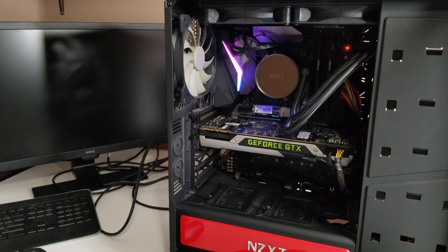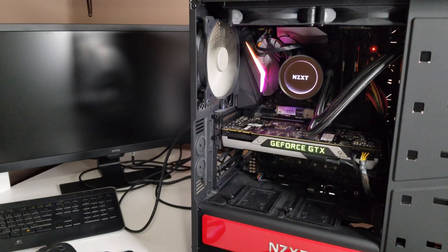Let's turn it on and see what happens. This is an Intel system from a while back — it's an i7-7700K. I'm still getting no display. But the system is not powering down. If the CPU was overheating, it would shut down. So I'm going to have to look and see if I can find any faults on the motherboard itself, because I am seeing a couple of lights and I'm going to have to check what they actually are.